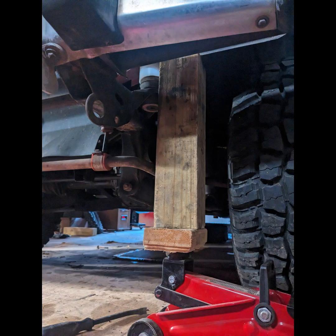Here's how I did it. I used a block of wood and Harbor Freight's cheapest jack available. Here I'm using the pinch welds. Some of the other spots in the back and on the body, you may have to be applying force to the body. So if you can use some wood or find some way where you're not pushing metal into metal. I didn't notice any damage where I use this, but use whatever best practice you have available.